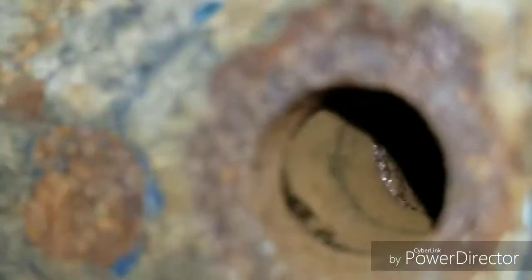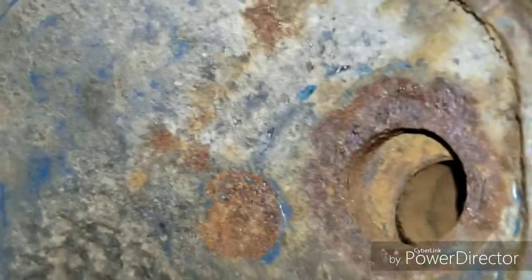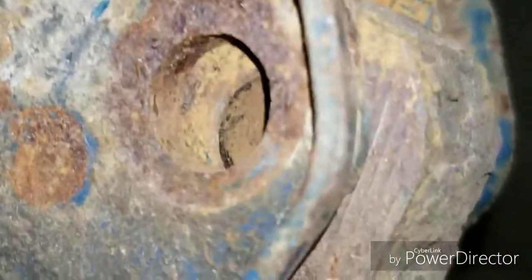It's kind of hard to tell, but if I really needed to, I could just hollow, even maybe just draw out the upper one for camber adjustment. That might work, but because I already have a camber bolt in there from the prior setup with the Mirage strut. But I'm going to test it out now. Get a bolt in here and test out the steering.